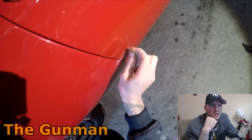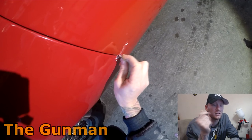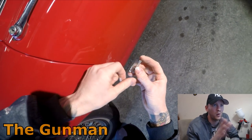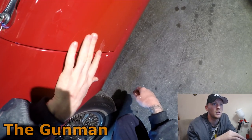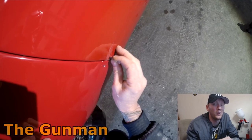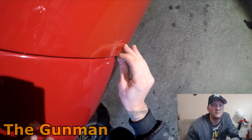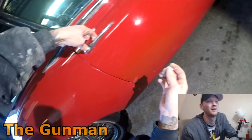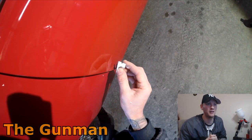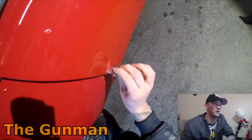This is that little run I was mentioning in the clear coat. I've got my tungsten denibbing block shaving it down — you could swap that out for a razor blade and just shave it down a little bit, block it out, polish it up, and off you go. Sorry, that was actually a razor blade there — it was a while ago I did this job and it's showing. You could change that for a tungsten block, but do be careful with those tungsten blocks as they can bite in and rip your fresh paint if you're not careful. A razor blade is probably a little less likely to do that.